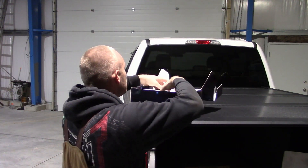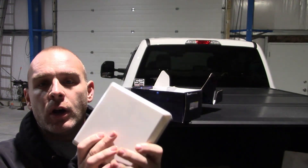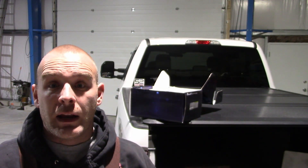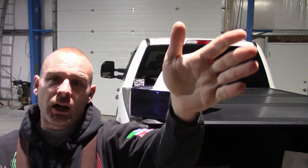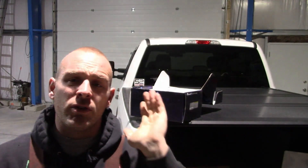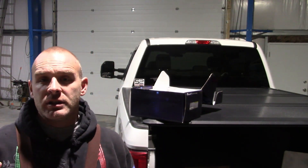All your manuals. So this is your outdoor receiver — this has to go pointing in the direction of your closest cell phone tower, and it says it reaches between five and eight miles, which is way longer than we need. We're roughly a mile and a half to two miles away. It's kind of a straight shot to the northwest, and this thing can be finicky — if there's a big tree line or skyscraper in the way it may not work. But luckily we shoot through a whole bunch of farmer's fields, there's a river, and right on the other side is the tower. So I'm hoping we'll get decent service, and being that it can shoot three to four times as far as we really need, that should help get a good signal in here.